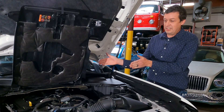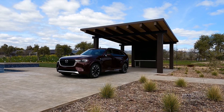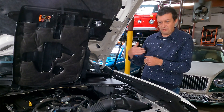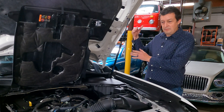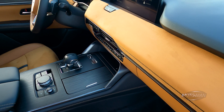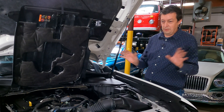What's different from the inline-six is that car had six cylinders and then a small electric motor for a mild hybrid system that could stop the engine and restart it, and do a little bit of torque fill — sort of fill in for turbo lag. And then it had the planetary gear eight-speed transmission where we use wet clutches instead of a torque converter. Getting rid of the torque converter makes room for that electric motor. That's how that whole system works.